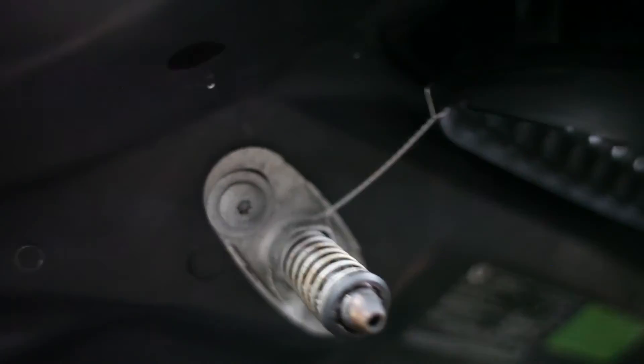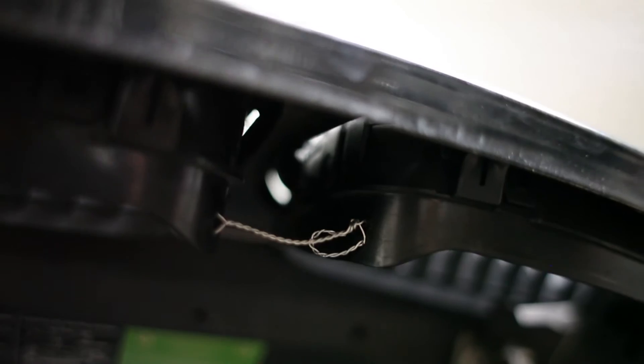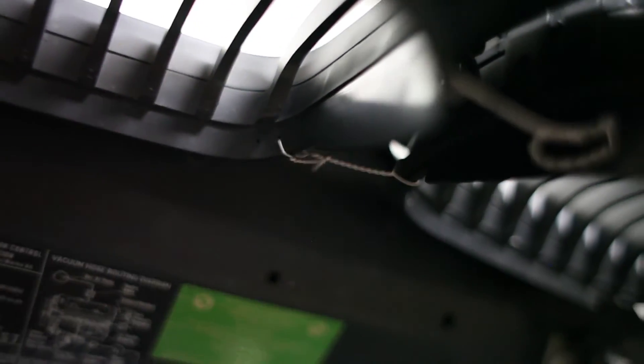Solid, tight — that's nice. Let me show you how I did it. I safety wired it from there to there on both sides — from there to there, and there to there. Maybe it's not the best safety wiring job, maybe it wasn't the smartest thing to do under the engine, but why not. I covered the engine with a towel so no shavings got in while I was drilling — that was smart. This is only part of what I was doing prepping for autocross. I hope you liked it. Maybe if you have loose stuff you can safety wire it, or maybe you have a better solution — if so, I'd love to hear it, comment below. Thank you for watching, please subscribe, and we'll see you soon.